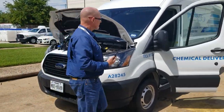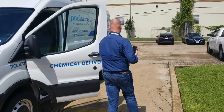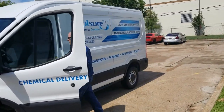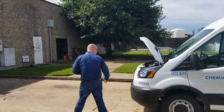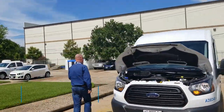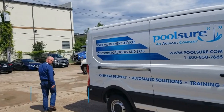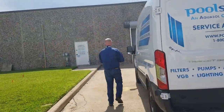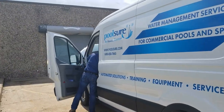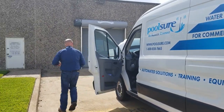We're going to come back around and we're checking lights. Now if you do this in pre-dawn hours, it's a whole lot easier for you to see reflections of buildings or cars behind you — anything that can give you an idea of what's going on. And don't forget to check that license plate light too; that's something that's often overlooked, even on our CMVs.